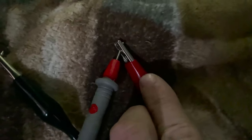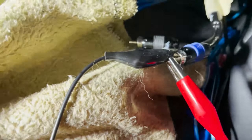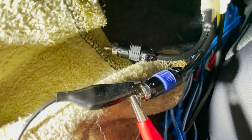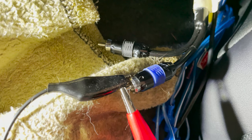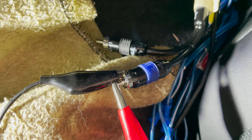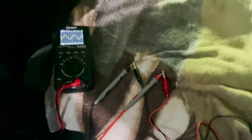To show you how I've got this set up: I've got these little alligator clips with a rubber cover. The middle part of the RCA cable is the positive and the outside is the negative. By clipping on this way, the shielding prevents contact with the positive, which allows us to get a good reading. If you're using high-level speaker inputs, you can just plug right into the wires with your oscilloscope. In my case I'm using RCA wires. Now we know when our head unit clips.